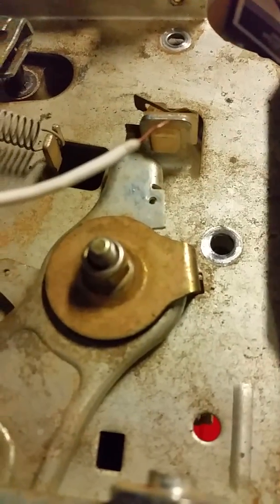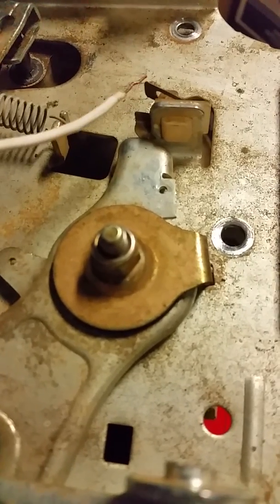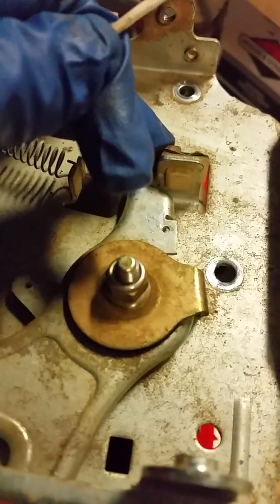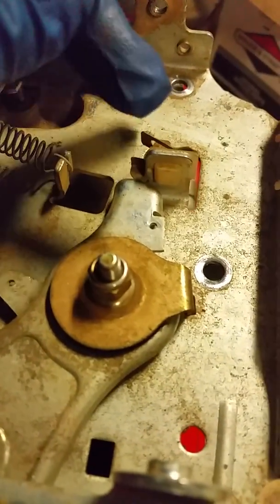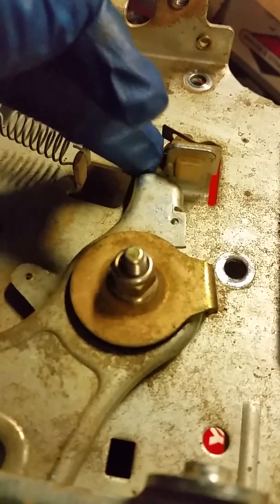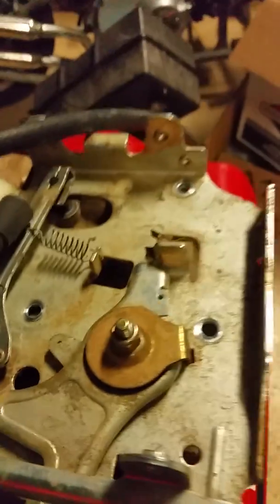This kill wire hooks into the back of the ignition armature, runs up under this bracket that houses the throttle, governor, and all that, and links into the kill connection. How it operates: once the throttle is closed off, it makes a connection and kills the spark — that's what turns out to be the issue. This little part goes up through there; you pull the tab back and it sits in this little plastic bracket, and when you kill the engine it pushes that and completes the circuit.